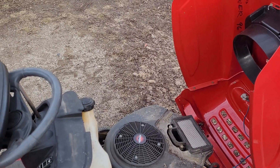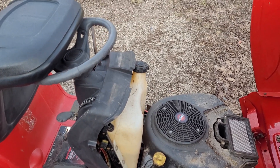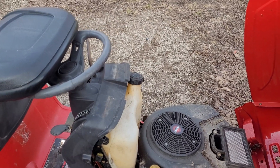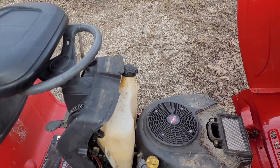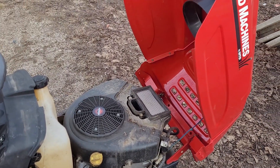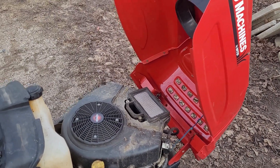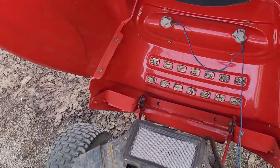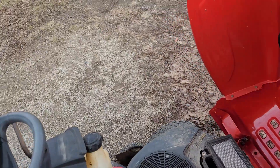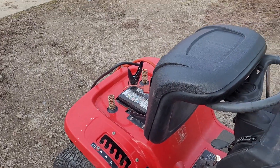Both air filters are in reasonably decent condition and could actually be reused. This one has well over half a tank of fuel — if I mix it with fresh fuel we might be okay, or I'll put it in my Allis Chalmers and use it. I'm thinking it's most likely a plugged fuel filter or just the intake to the carburetor is plugged — I've worked on a lot of these engines in the past and it's pretty common. This machine also has all its bolts holding the hood in place and I put the battery in it.